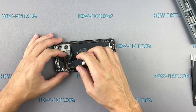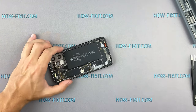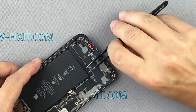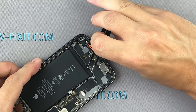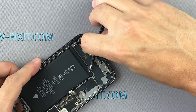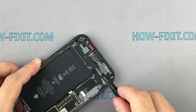It is now possible to slide the motherboard and attach it to the top of the battery. After removing the silicone tapes, we can conclude that in order to replace the battery in the iPhone 12 Pro, you need to take many steps — more than 70% of the smartphone has already been disassembled.